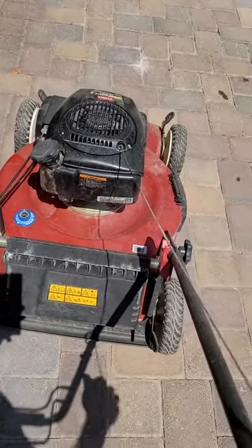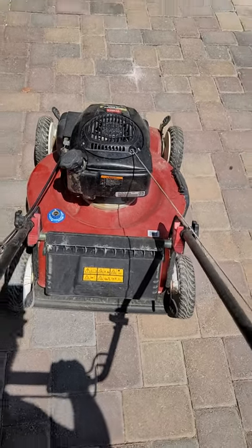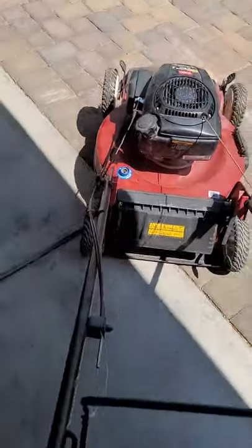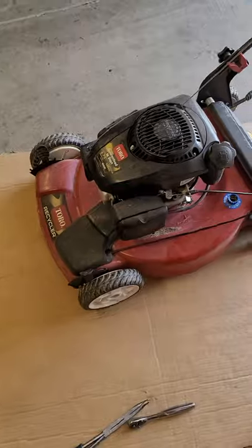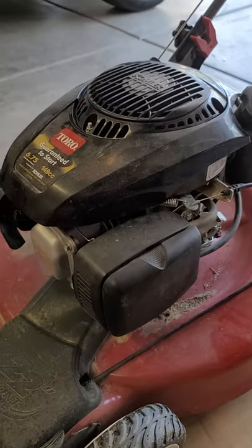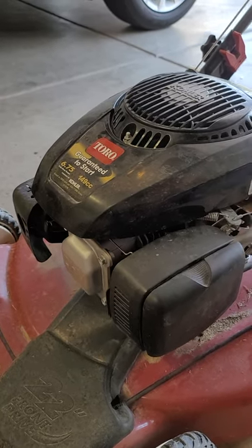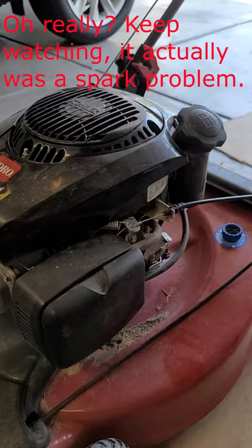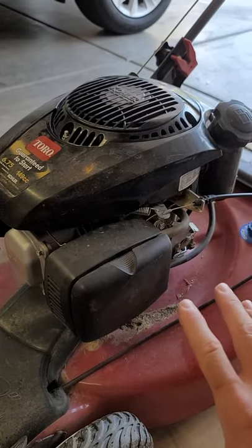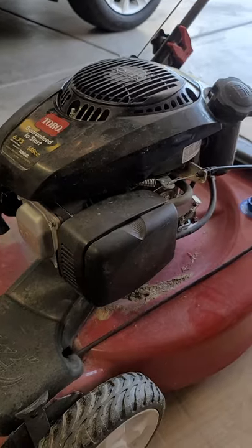See if I can get it to happen. Okay, so clearly indicating some sort of fuel problem. Let's get it in the garage. We know just by that little test there that we've got some fuel in there, that spark is good, compression is good. You don't have to worry about changing spark plugs or rebuilding your engine. What you're going to have is basic airflow or fuel delivery problems, and this shouldn't be too terribly complicated to figure out.